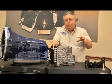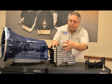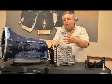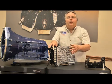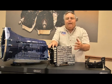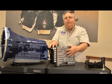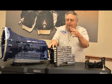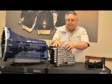You buy a transmission out of the yard, especially if it's had water in it, you're going to have water in your old valve body. You're going to hook up a controller and hope it works, and you don't know. You may be fooling with the controller trying different programs when it's this part right here — laying in the field or in the mud for who knows how long. It's well worth the investment to replace this.